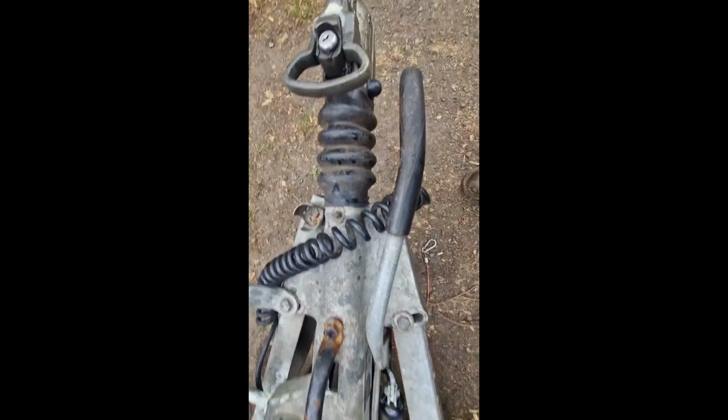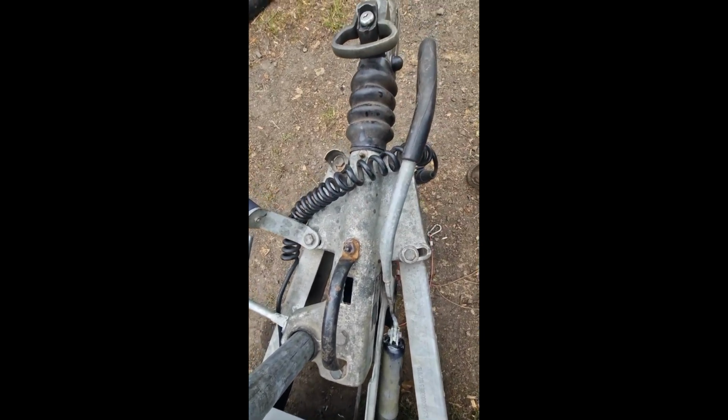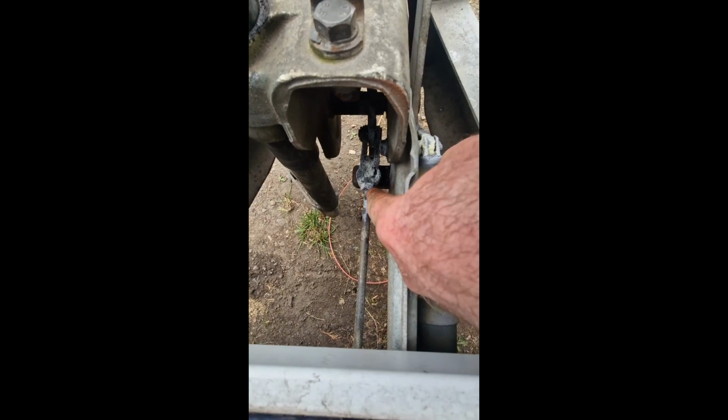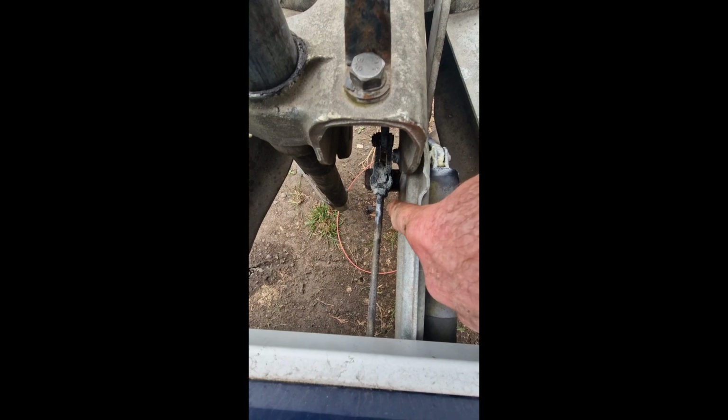Right, so after adjusting the brakes, I've lubricated all the cables there underneath, so we can try the brakes on the handbrake now. Right, and so I've greased the two grease points for the slide on the drawbar. I've lubricated all the pivots. I've wound this rod back to where it should be, put the check nut back, because before adjusting the back brakes I slackened this off. Always work from the back end forward.